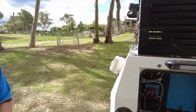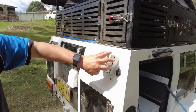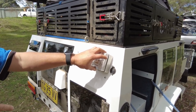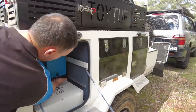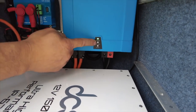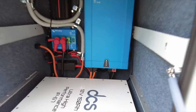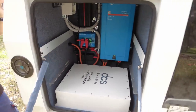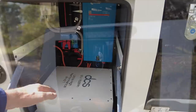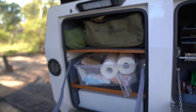If the car is parked up at home, I just plug it into 240V. The MultiPlus will detect the AC voltage automatically. Providing you've got it on the on position — there's a toggle on the base — you'll hear a click inside the unit, then the charge light will come on in amber. I converted that compartment because there was originally a drawer here — I took that out and have two shelves going in, so I still have room in there.